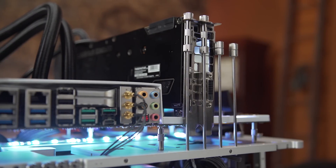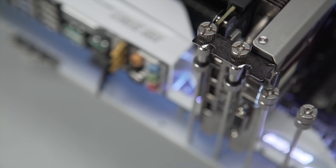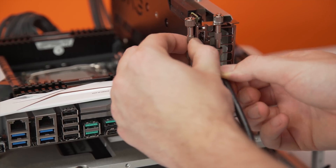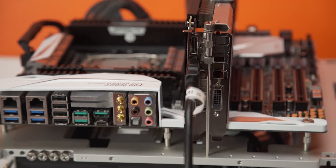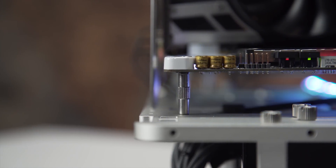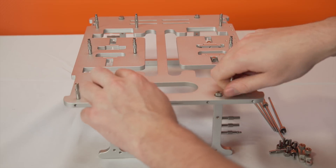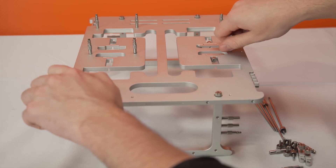And there's more than just screws built in — literally everything you need is here, like your expansion card standoffs, which work surprisingly well considering the issues I've had with very similar designs in the past where they would wobble and fail. Though you may have some issues trying to plug in display cables like HDMI or DisplayPort due to the need for them to be non-flat. It's not that hard to avoid, however, if you're comfortable with just one standoff per card — just remove the top one. You also have your choice when mounting your motherboard of pin-based screwless standoffs and a more standard system. I opted for a mix, mostly screwless standoffs with a couple of traditional ones. Ease of use is very important on a test bench, and not needing to screw things in is paramount.